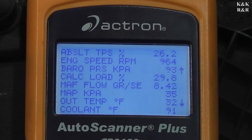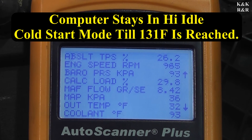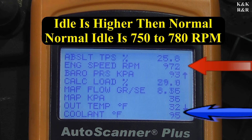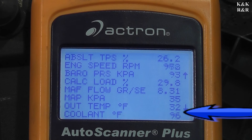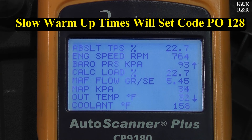Check and see if she's got a little bit of heat on the inside yet. Use the vent — try not to use the defrost. We're almost at 100 degrees so you should have a little bit of heat. Alright folks, we're going to call it here. We got the fan issue dealt with. The fan should never be on unless this thing is up to temperature or you have the air conditioner override on — and when it showed up it was running with the fan on, which is incorrect.